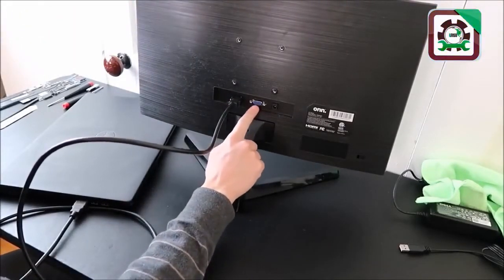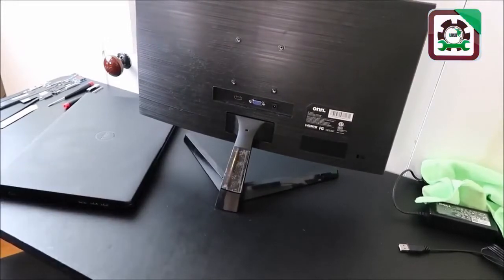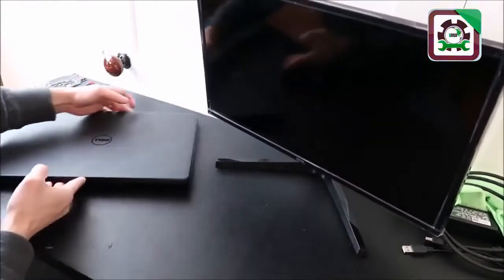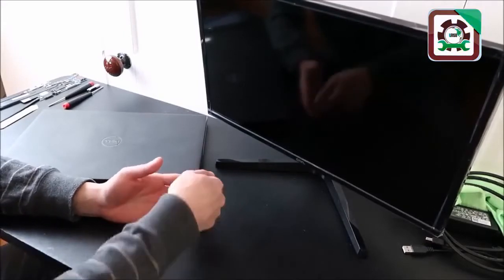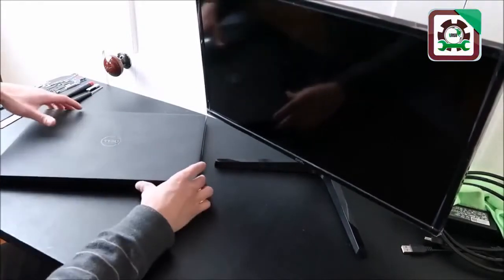On older computers you can also use a VGA cable to hook up your external monitor. Once you've hooked up the external monitor and try turning it on, if the external monitor works and displays a picture but your laptop screen still does not, you've identified your issue — your motherboard is working properly and sending out a signal, but your LCD or LCD cable is faulty. At that point, you would reseat your LCD cable — meaning unplugging it from the motherboard and plugging it back in, and possibly unplugging it from the LCD itself and plugging it back in.